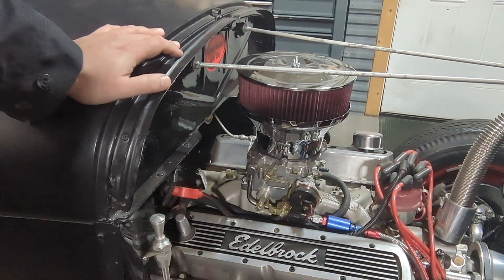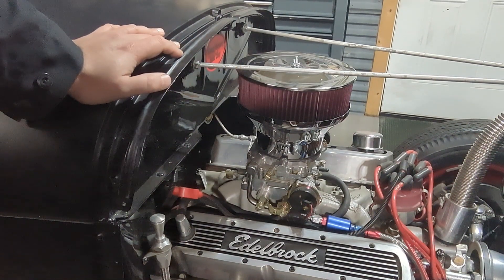Transmission — the only way to check it is to get underneath the car. I did see a little bit of seepage around the pan; I think it could be a loose bolt or the gasket needs to be replaced. Good thing I have another one.